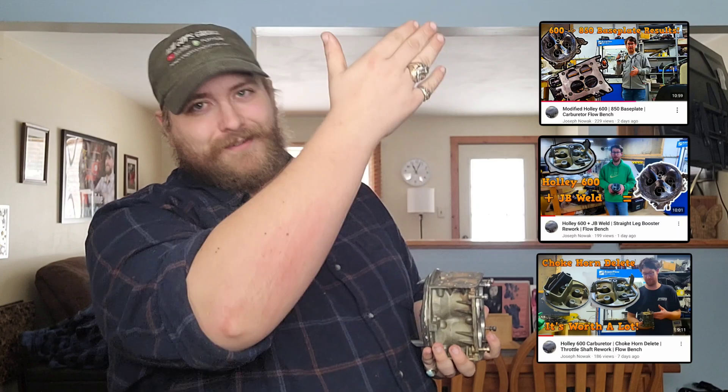I'm just tossing out numbers at you left and right here. I encourage you to go watch Joseph Nowak's series on this carburetor and him flowing it. He has all the data spreadsheet out in a nice spreadsheet where you can clearly see all of what's going on. Highly encourage you - you gotta go watch it for the nitty-gritty details. He flowed it at multiple different depressions, which is basically just how much vacuum you're putting on the carburetor to get the numbers. He had to flow it at many different ones because right out of the gate this thing maxed out his flow bench. Then he had to lower the amount of depression each time because we kept maxing it out. I'm telling you, this thing has got some potential left in her.